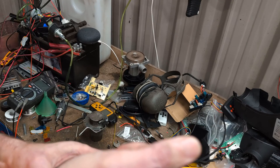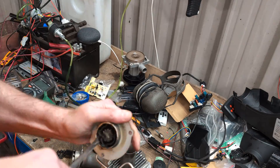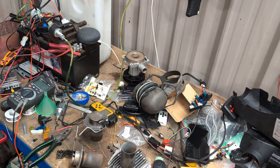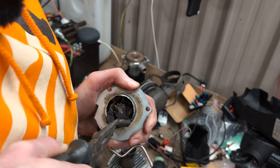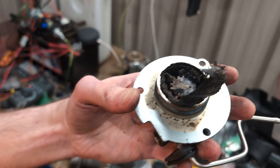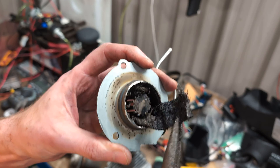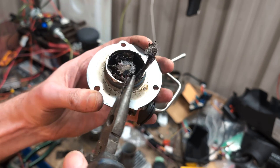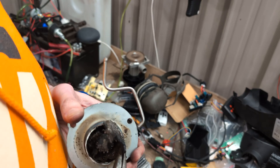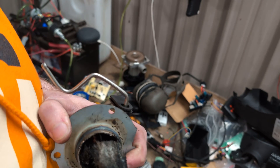I will destroy this one to show you — I might need a bigger screwdriver. This is the wick material. It's basically just flat wire wool and then another wire mesh on top of it to keep all the wire wool together. That is obviously to wick the diesel vapour round about the outside of the burn end of the burn chamber.